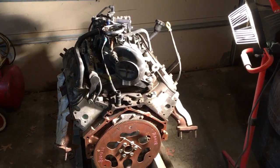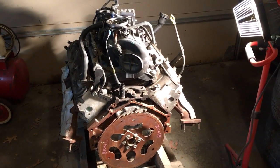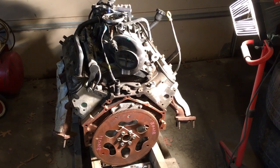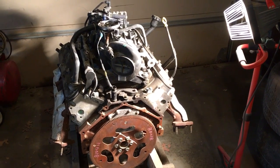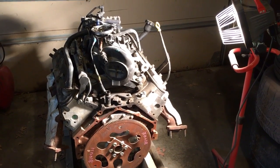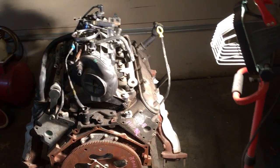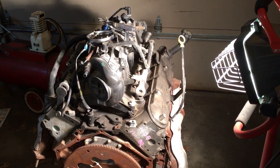I'm trying to put down 550 to the wheels. With that in mind, on eBay — Pro Comp Electronics — they have two sets of valve springs. You can buy either set for forty-one dollars and fifty cents, and yes, that scares the living crap out of me, because most any other spring worth talking about is 140 to 190 dollars. Pro Comp has a single beehive spring that's supposed to be a drop-in on these LS motors: same 1.8-inch installed height, good to 520 lift, 150-pound seat pressure.